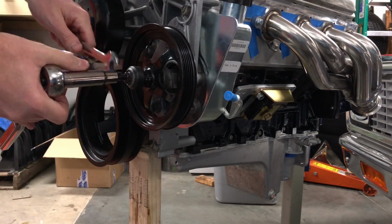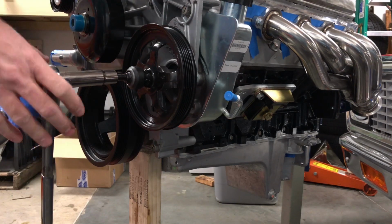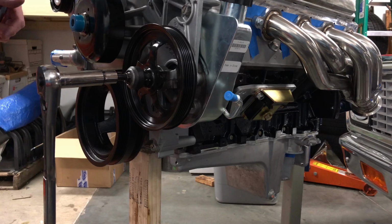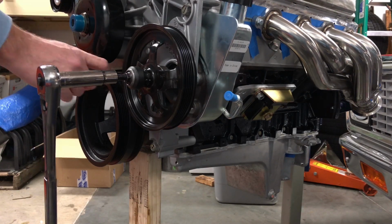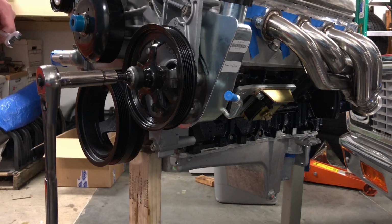The trick here is you've got to line up the pulley with the crank pulley. So what I'm going to do is get it onto a point, and then I'm going to get a string and wrap it on, because we've got known points up here, which is probably out of frame, on the alternator, and then on the tensioner over here, and on the crank. So I'm going to run a string around all four of these, and I'll set this exactly where it needs to be.